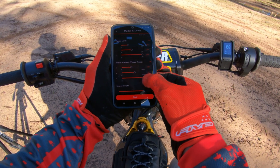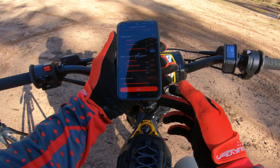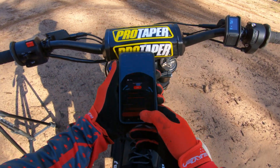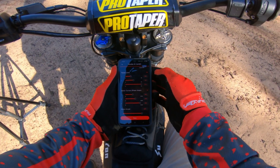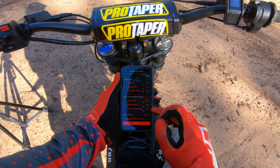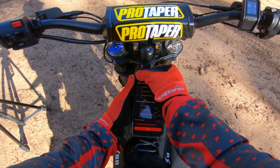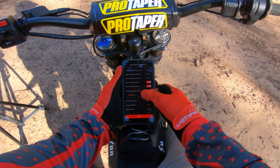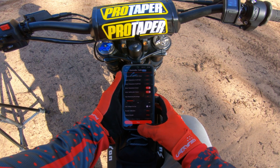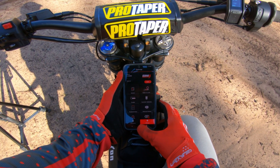I'll change that up to a thousand — I'm not too sure if I can get a thousand because this is the V1 controller. I'll drop back to 900, as this V1 X9000 is only good for 900 phase amps; the V2 is good for a thousand. In the controller settings, field weakening is at 30%, which hopefully gives me more bottom end.